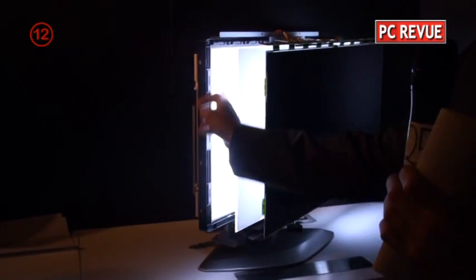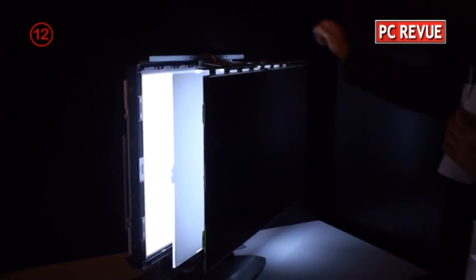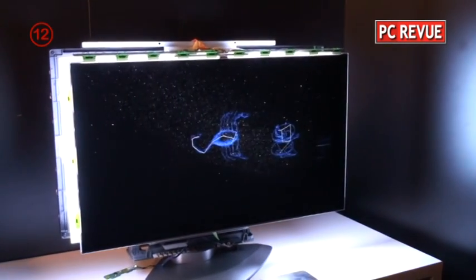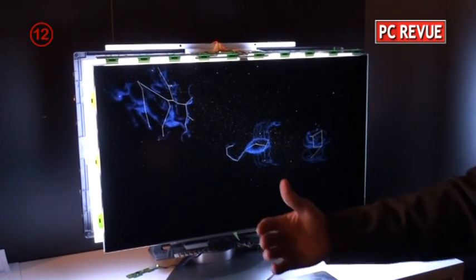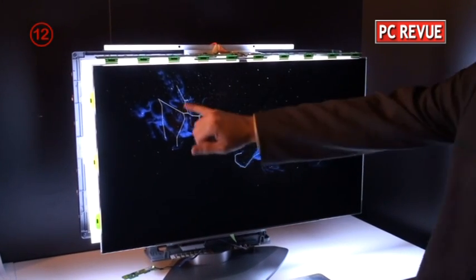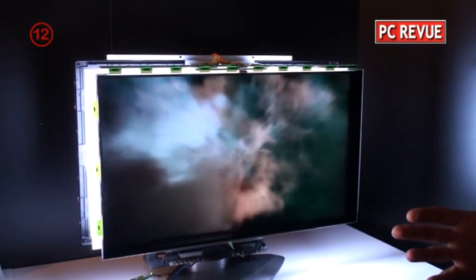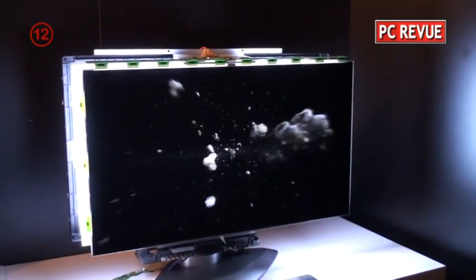You can see here — this is a backlight, this is CCFL technology. Depending on the content, when the content goes from the black level down, the backlight also goes down, and this is the reason for deeper black. But when we have scenes like this with light here, light here, but dark scenes here, it is not possible for this kind of lamp technology to dim locally. This is also the reason for not achieving really true black with this LCD technology.